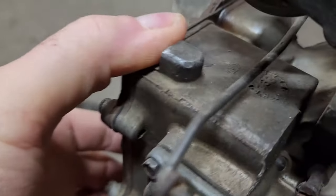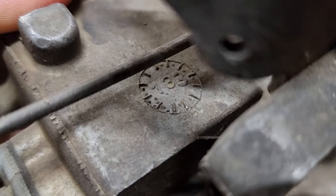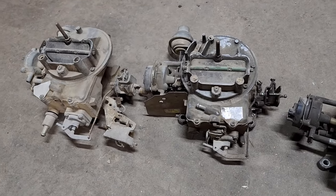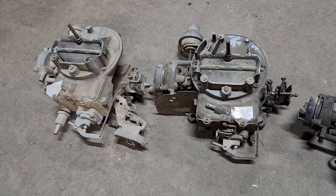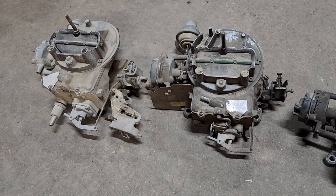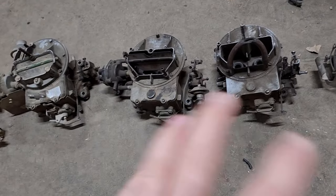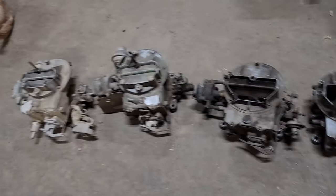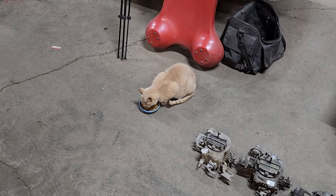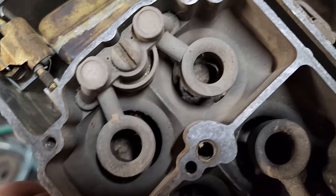This is another 2100, a rare hard-to-find one with 133 Venturi size - I actually have two of these. And then these two are just some garden variety 121 Venturi Motorcraft 2150s. I'm not going to totally rebuild them, just pull the tops off, pull them down, throw them in the solution and see how each one comes out. There are mud dauber nests down in there too.